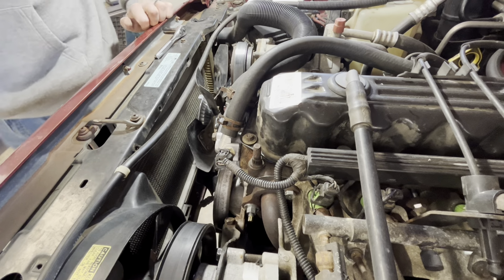All right, so let's see if we can get the light here. You guys can see, it's so tough to video some of this stuff. I can see it plain as day, but all right. So right here, that pin is way farther back than that one. It's not anywhere near where it's supposed to be. See how it comes right out? And this one's tight. Okay, so this is a pretty standard pin, at least for working on Jeeps. It looks like the whole thing's there. A little bit burnt on the contact, so probably what happened there, if I had to guess, it wasn't making good contact and then it was arcing and stuff. See the light reflecting off the tip?